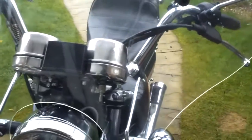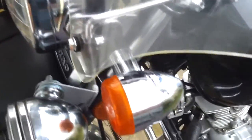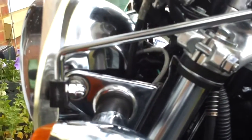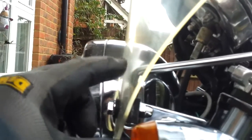It didn't take me very long, just most of my life. There, this is my way of fitting it on. There are probably easier ways of doing it. That there is the bracket that I had to increase that angle on. Stick it in the vise and just lever it up a bit, because otherwise if it was still 90 degrees there, it would be putting so much pressure on this perspex.